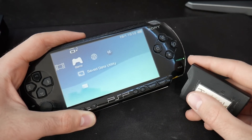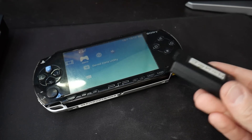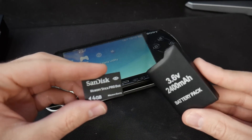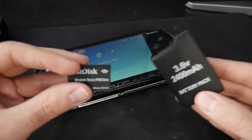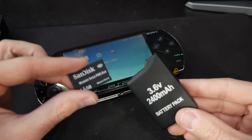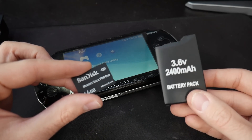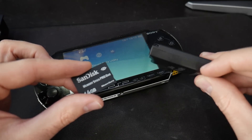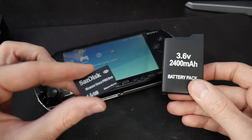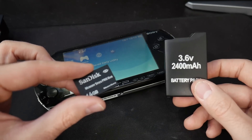Once you do that, you kind of have full control over the PSP. This works for modding, but even more importantly it works for restoring, preserving, and really just unbricking a bricked PSP. Yes, even a PSP that is completely fully bricked - I can wipe the flash completely, and if I have a magic memory stick paired with one of these Pandora's batteries, I'm able to restore the PSP completely. There was a couple of ways to set up the battery - one involved cracking it open and making a physical modification, but we are not doing that here.